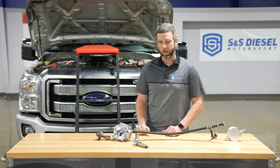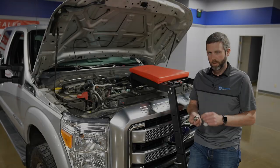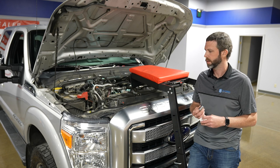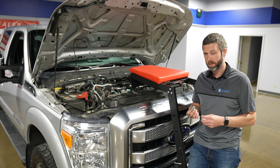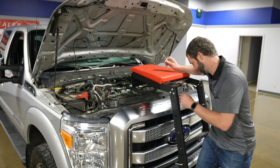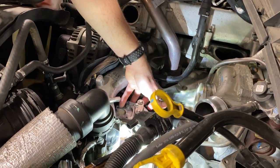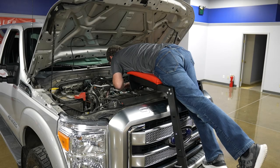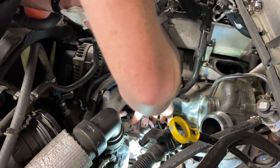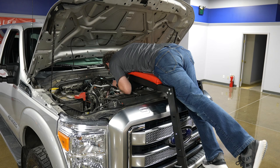So we're going to get back to it — install this damaged roller, wreck this pump, put a hurt on the truck. One of the main things any Ford Super Duty owner dreads is a failed high-pressure pump that takes the truck down without warning and results in a really expensive repair bill. We're going to do that intentionally on purpose. Here's the damaged roller getting installed now. And here's the actual pumping head — that roller compresses that spring as the cam goes around. Checking to make sure it's turned 90 degrees, the absolute worst way it can possibly sit on that cam.